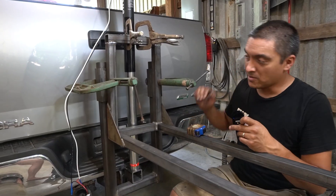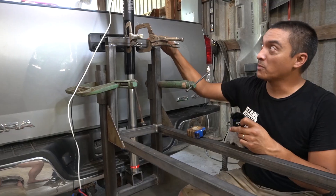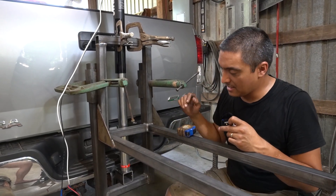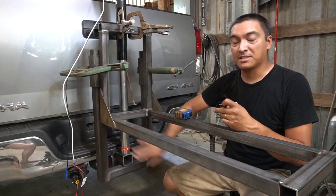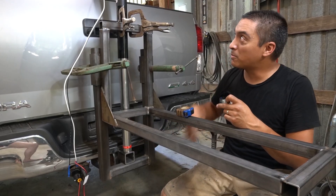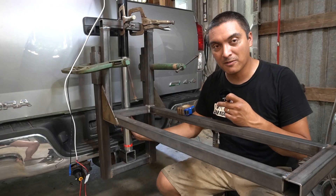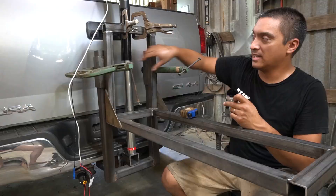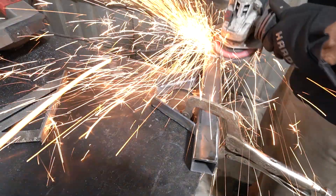I extended the wires temporarily for my trailer jack and ran it to the all the way up position. Taking some measurements, I think I'm about an inch shy of my goal height because the dimensions for this jack provided online by e-trailer included the shoe. No blame on their part, it was just my fault for not double checking before I put this together. So I'm going to cut this apart and lower it an inch, which will raise the platform an inch and get me the height I want out of the carrier.